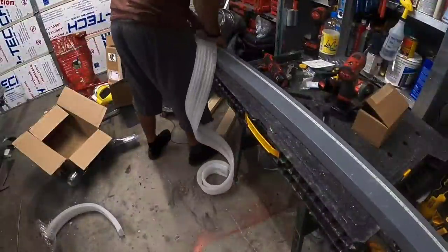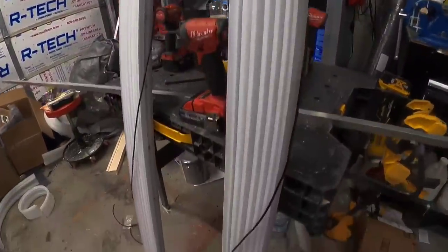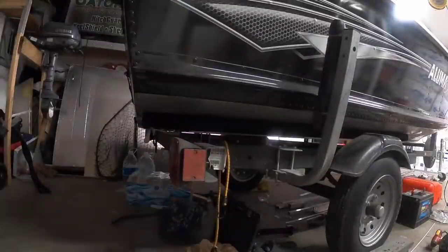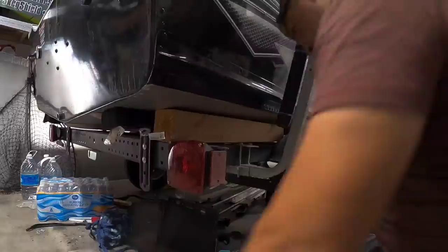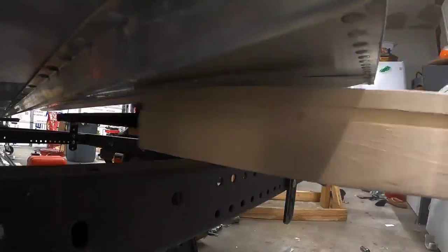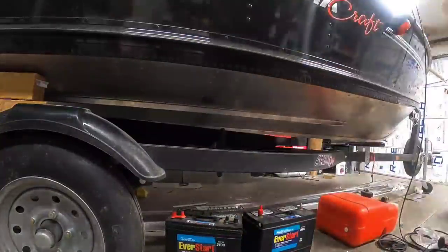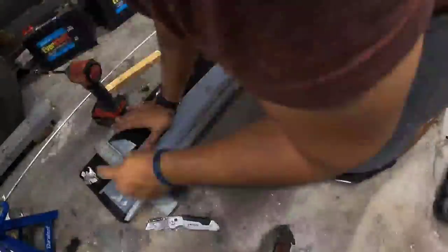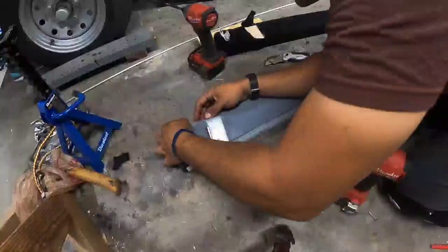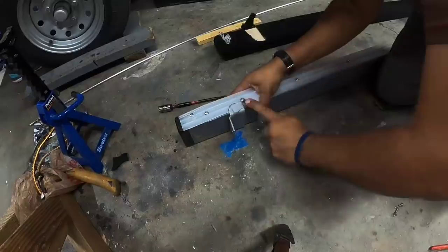Note that you don't need to use the lights — they have straight black bunks that look really good, and also the clear versions if you like that look. They look nice with or without lights, but even better when lit up. Now to install them: we're going to install a bunch of 4x4 studs underneath after moving the trailer. The boat here is really light, but with a heavier boat you'll likely need a car jack with secure braces and frames so the boat doesn't fall on you. We'll match up the brackets, mimic everything as it was, and transfer it over, installing those bunks just as the stock ones were installed.